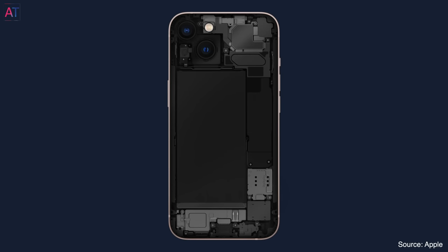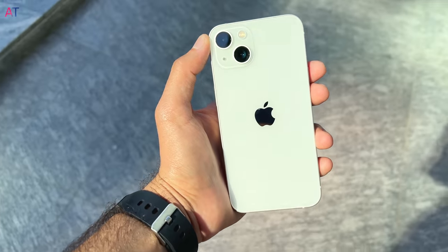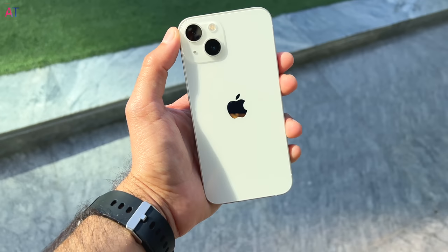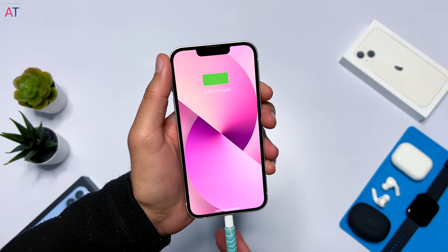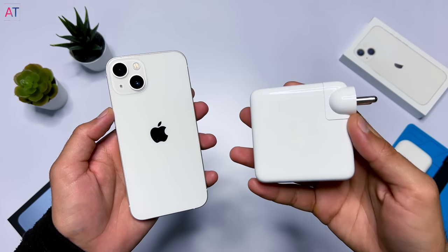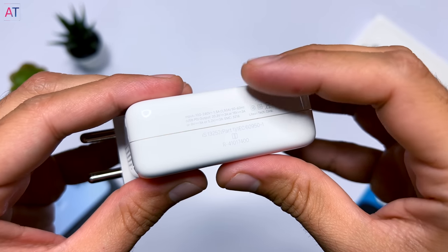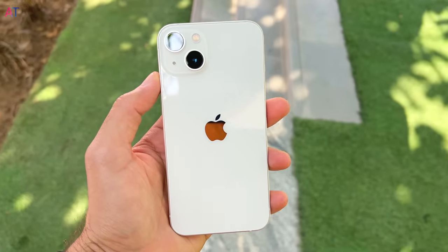Because the phone has been redesigned internally, the battery is 425 mAh larger than iPhone 12, totaling 3240 mAh. Compared to iPhone 12, battery backup in normal use is about 1.5 to 2.5 hours more. iPhone 13 also supports fast charging — you can purchase a 20W adapter separately. Using a MacBook charger (61W adapter), you can also fast charge your iPhone. With a fast charger, you can charge the phone from 0 to 50% in just 30 minutes.